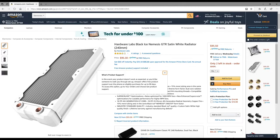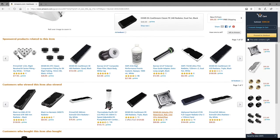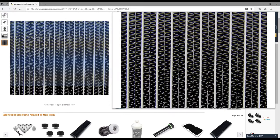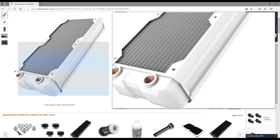When it comes to radiators, you do not need a hundred dollar radiator — you don't even need a seventy or forty dollar one, just something that gets the job done. All radiators are G1/4 threads so you don't have to worry about that. The main difference in radiators is the number of pipes or channels — each channel is where the water actually runs through, so it might say this is a 12-pipe or 18-pipe radiator. The second thing to look for is the thickness of the radiator.